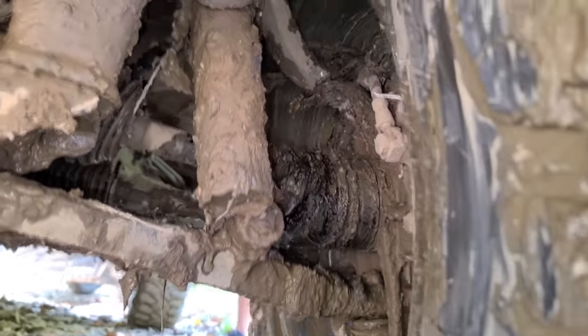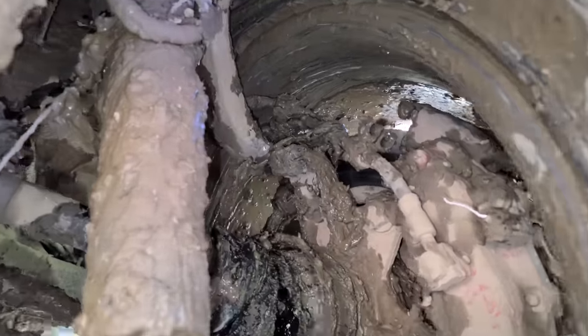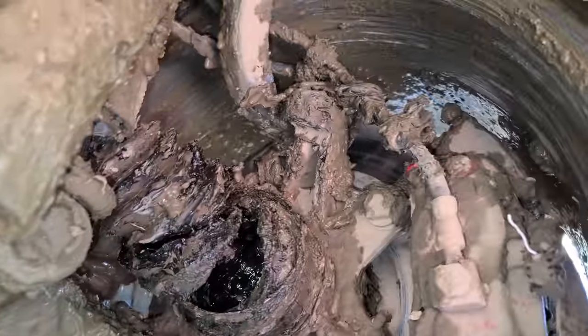Look at that boot. That's not good. So we got that, oh, I see. The upper ball joint, it totally is out of the spindle. All right, yeah, go there. Whoa. That is the spindle. That down there is the upper ball joint. It's supposed to go through there, and that is completely out. And the axle boot ripped, okay. Wow, that's not good. All right, well, mission accomplished. We definitely broke it. Now we just gotta get it back.